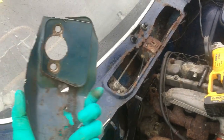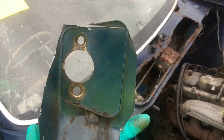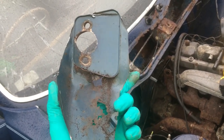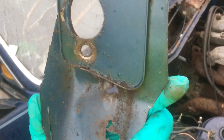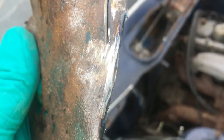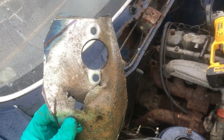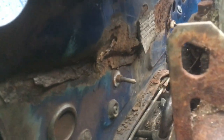That's the offending area. That's the reinforcing plate on the back which I tried to miss, and it looks like I've just about caught it at the top there - so that's good because it means I can get a new section put in really nicely. There's a bracket there which I think was just to hold the sound deadening. Most of the parent metal around here is good. It's just some slight surface on the top where I've kissed it with the grinder - very minor rust where probably clutch fluid has taken the paint off the surface. That's the hole I'm left with. It didn't catch fire, which is nice.